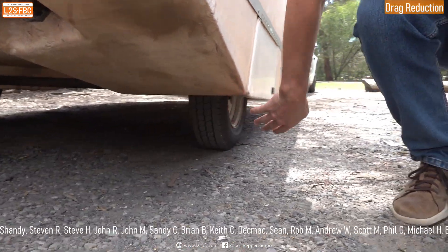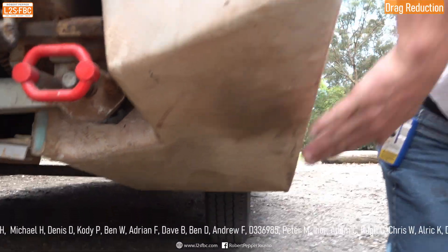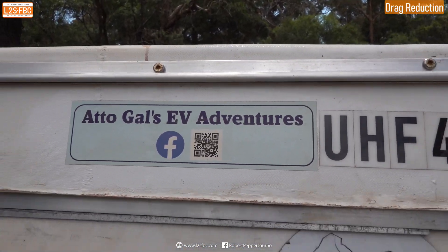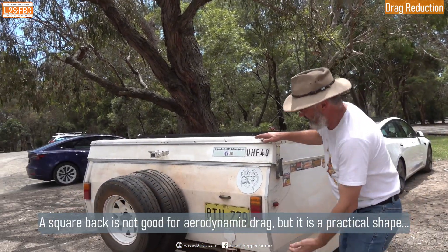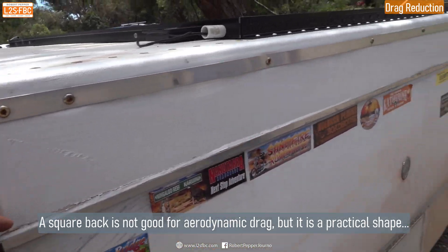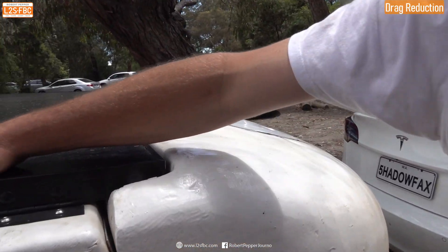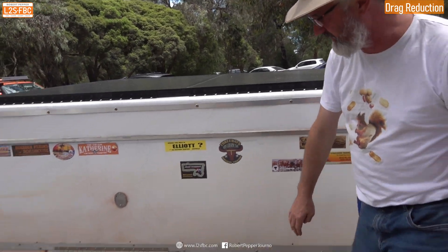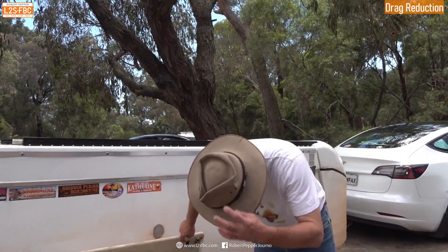Down the back here I picked up the same line where the front aero starts and brought it back as high as I can, to reduce the area of the low-pressure zone at the rear. Ideally you'd want a teardrop shape at the back as well — that would reduce drag further. The aero lines up nicely, which reduces separation there as well. The hatch at the back is an inspiration from the 60s — you lift it up to check tyres and make sure everything's going.